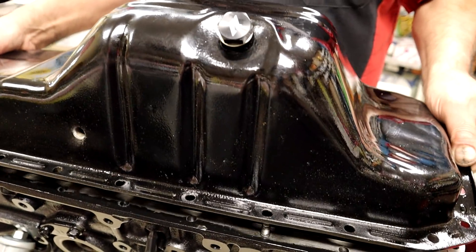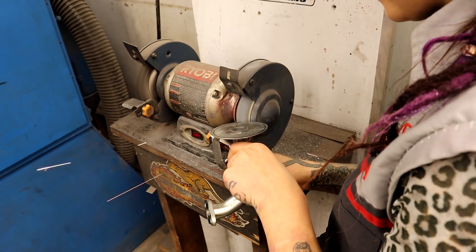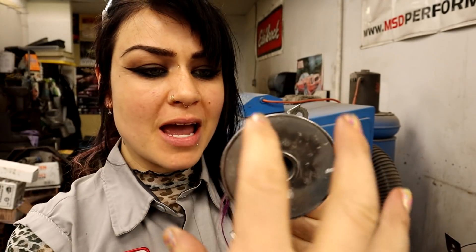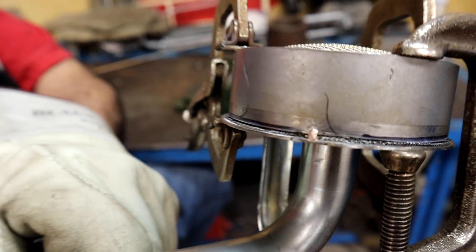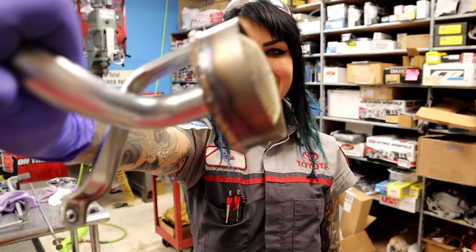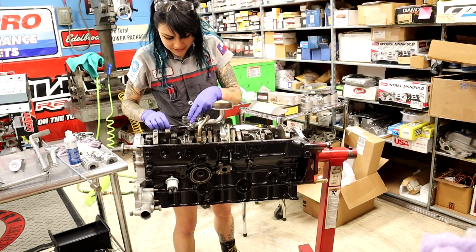Here we are — that's going to be good, right? That's excellent. That's about the spacing we want. So all I did was cut along the outside edge here — this sharpie line is where the pipe fit perfectly. I made a line, gave a little bit of a lip there because Danny's going to do some welding, and I sanded down all the burrs and removed the galvanized portion from the outside where he's going to be welding. That is the world's smallest weld — that's silicon bronze. That's going to work. This is a lot thicker than the mesh, so I was afraid the mesh was going to just disintegrate, but as you saw from the beginning, the mesh did not disintegrate at all. Danny did a perfect job and I'm so stoked on it. Now I'm going to go install it. Thank you guys so much for watching my weird little Saturday project video, and I will see you next time.